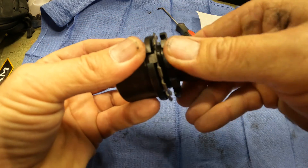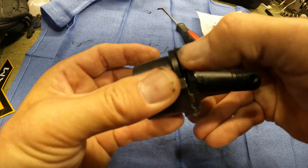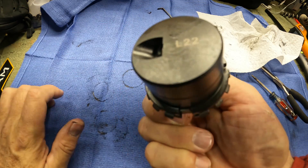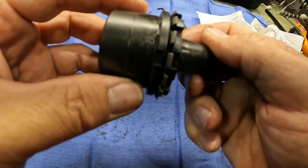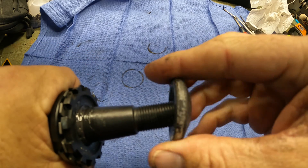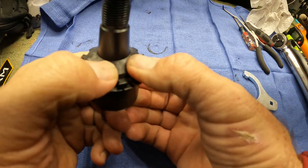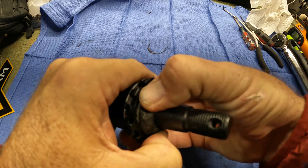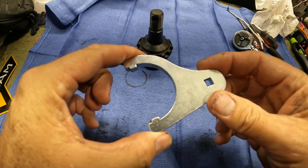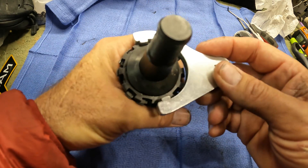We'll just screw it back together here. Of course, if you're rebuilding this on your vehicle — the goal is to be able to rebuild this on your vehicle — it's going to be upside down. So you're going to have to get underneath it safely and use some grease to keep all the parts in place. Don't forget to put your seal back on, concave side towards the ball joint. It does kind of press in around the edges, so make sure to get it seated nicely. Then you're going to use the adjuster tool, or they call it a crow foot in the instructions — just a spanner wrench that goes over like this.